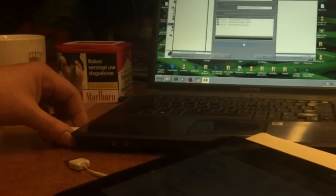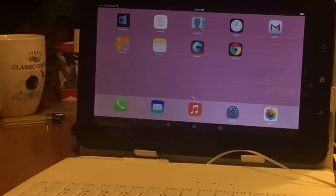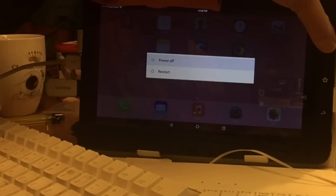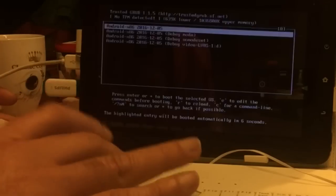We're going to put the stand aside — the keyboard stopped working, which is useless. We pop in the keyboard and the USB stick, press power, and hit F11. For me it's F11 on this tablet, but on the Acer Iconia it's F10. Look at the bottom of the screen — it should say F11 to boot from device.